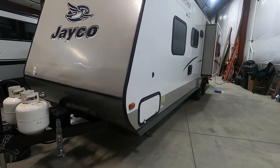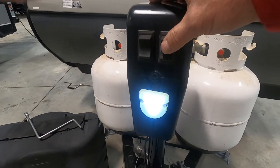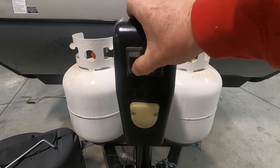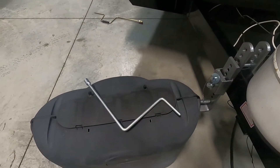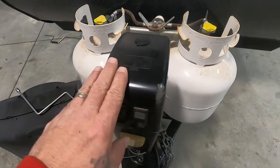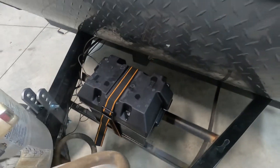Once you unhook your hitch work, the first thing you do is level your unit. I recommend getting a stick-on level — put it on the side of the unit, find the middle, put it on there, and have someone watch it while you use your power tongue jack. You have a docking light here in case you arrive at night. Simply raise or lower the unit. Should you lose power, there's a little rubber stopper here — pop that up and you can use the hand crank on it. Also check your battery posts to make sure those haven't wiggled loose bouncing down the road.